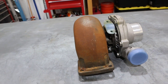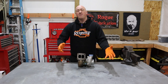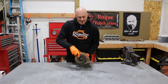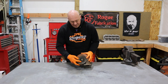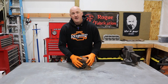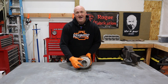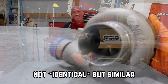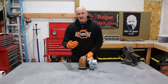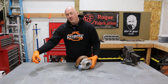Now, how do these two sides work in relation to each other? A turbocharger is making use of waste exhaust gases already leaving your engine. You have a turbo manifold which funnels all of those exhaust gases into the turbine housing. What this does is it runs them around inside the turbine housing, spins them around, and spins that turbine blade extremely fast. This blade is connected by a long shaft through the center housing and into the compressor housing, which itself has an identical blade mounted on it. So anytime one blade is spinning, the other one is spinning as well — those exhaust gases spin the compressor blade, drawing fresh air in the inlet and compressing that air, pushing it out toward your engine.